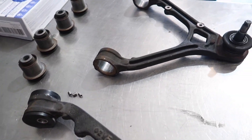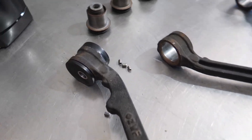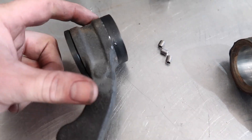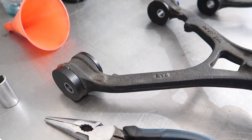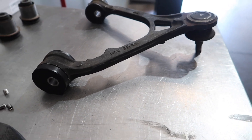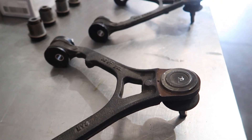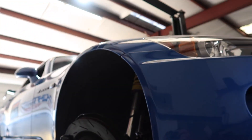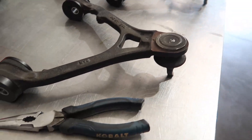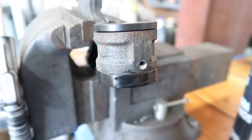There's one done, then we'll do this one. You've also got to be quick because you have to freeze these to make them small enough to go in and they warm up pretty quick. Once we have them all in, we have some set screws - we'll drill and tap the back of this and put the set screw in. So there's both arms' bushings installed. We've effectively shortened the upper control arm to add more negative camber to tuck in the really wide TE37 wheels - I believe they're a 10-inch wide wheel on the front of one of these cars with stock fenders, which are trimmed and rolled slightly. That is definitely a lot of wheel for this car, so this is going to make it tuck in there real nice. There's the first hole drilled, then tap - you want to make sure you go through the metal and into the delrin slightly so it has a spot to lock into.